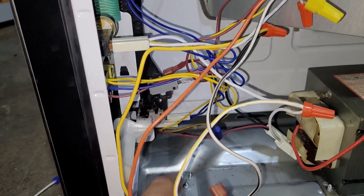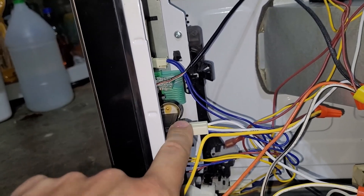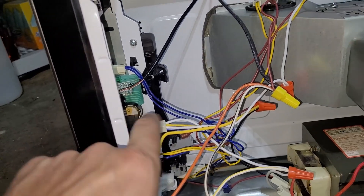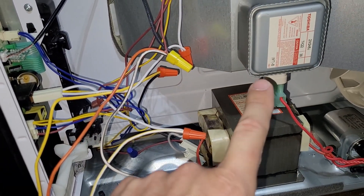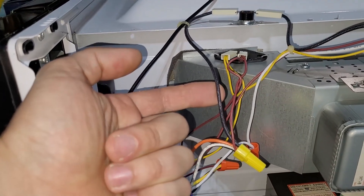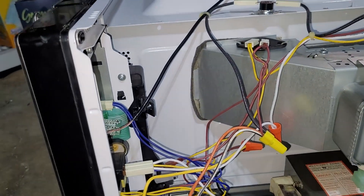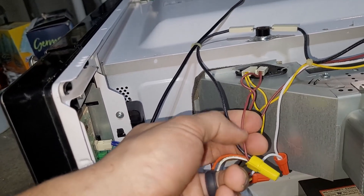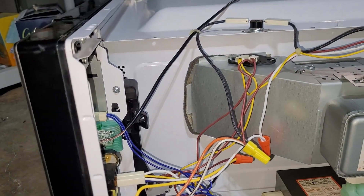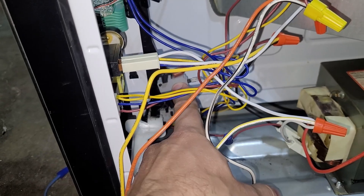It's a door switch — there are three door switches in it: one, two, and three. The one at the bottom reports to the computer to tell it that the door is shut and that it's safe to run the timer and trigger this relay. This relay breaks the neutral going to the transformer, so when this relay is engaged, the transformer gets power and makes enough voltage to run the microwave emitter. The door latch on the top broke the hot 120-volt circuit coming off the other side of the coil for the transformer — it also broke the hot going to the motor that spins the food.